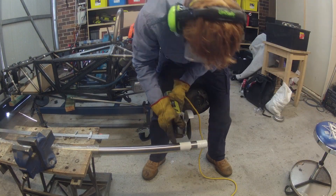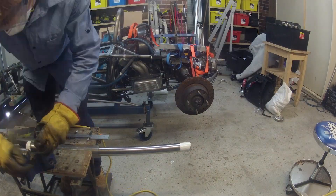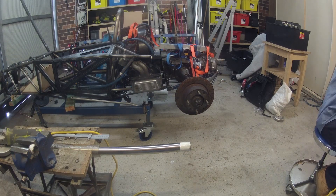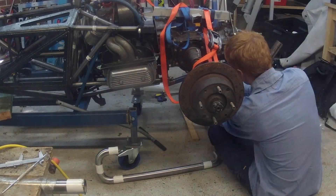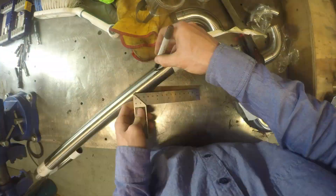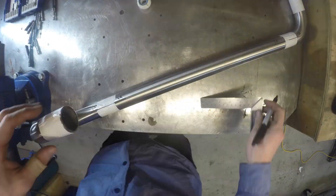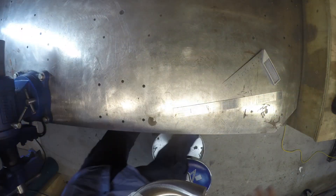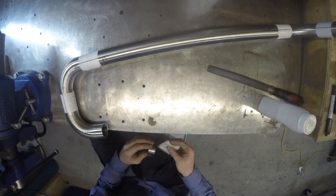As with the chassis, the first step was to cut the tube to length. I found using tape to mark the line helped, as it was easy to produce a square edge that was readily visible while cutting. I tried two different techniques for accurately welding the tube. The first was to tape the pieces together and mark four locations around the circumference to allow me to weld. I wasn't so happy with the accuracy of this technique, plus the parts tended to move slightly as I was working. I ended up fabricating subsections of the complete exhaust runners then tacking them together in place on the car, which seemed to be the simplest way of achieving a good result.